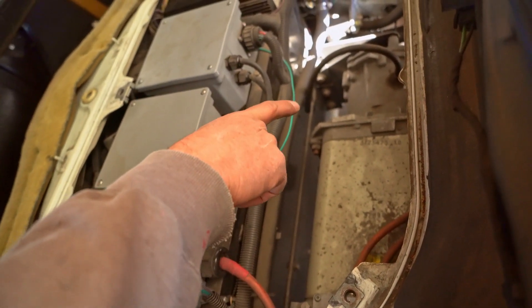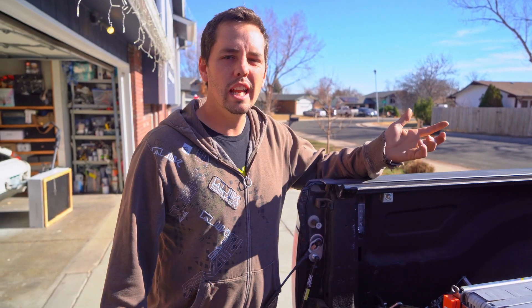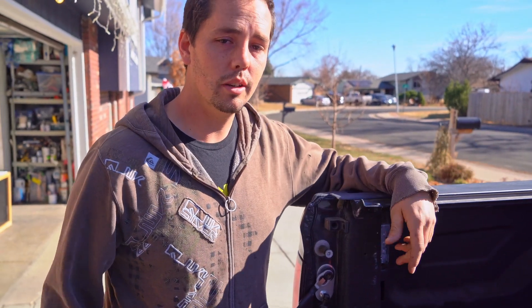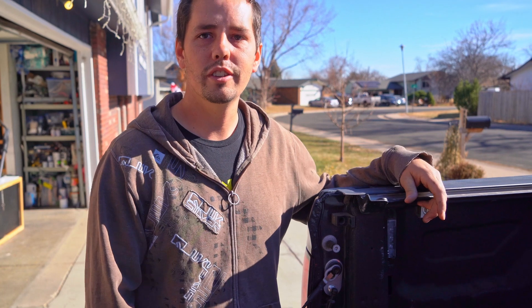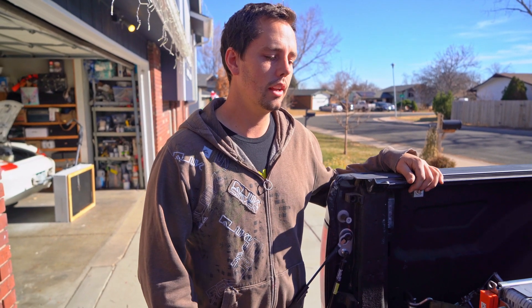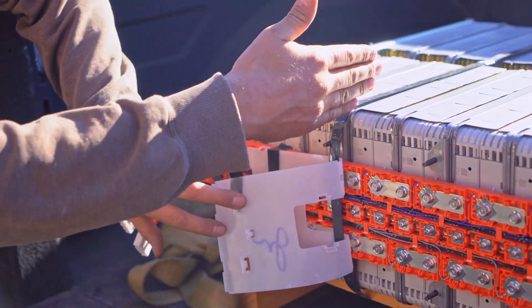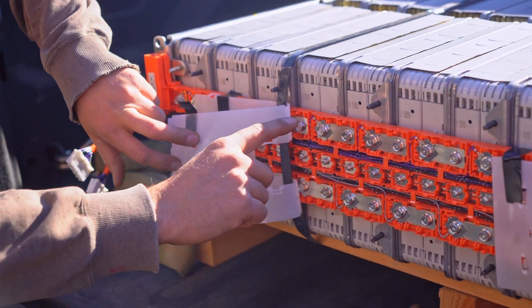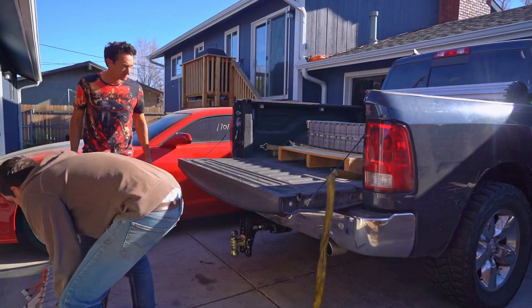This is a 40-kilowatt-hour Nissan Leaf battery pack, which should give about 180-mile range in a normal car. Off-road will be a whole different story with different power draws. The Razor is way lighter than a regular car. You usually only go about 50 miles in a day in a Razor, so we'll see how it compares — I think this will be more than enough for a day of trail riding. You can see the individual battery slices with bus bars putting them all in series, and little wires connected to each one going out to connectors so the battery management system can monitor them individually.